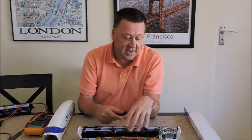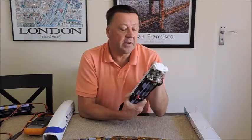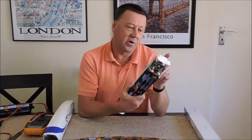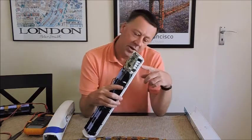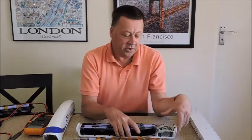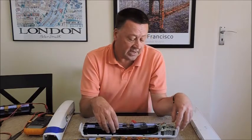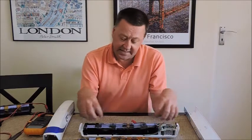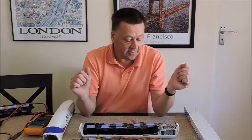One other tool I have access to: BH actually supply a very nice diagnostic kit for their resellers and dealers that plugs into the battery. The interface on the battery is actually only for the diagnostic kit — the bike itself only uses positive and negative. All of the BMS information can only be accessed through a special cable and a USB UART device manufactured by a company called HiTech. HiTech, I believe, are the battery partners with BH, and they produce very detailed diagnostic data from the BMS showing the exact balance of each of the 10 packs that make up the 36 and 48 volt battery packs.